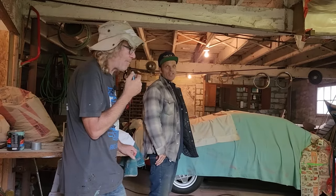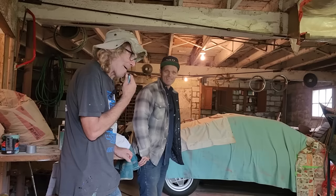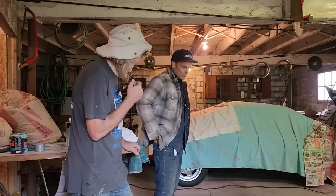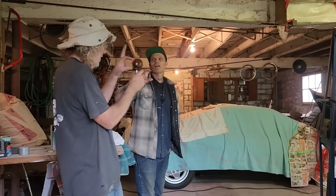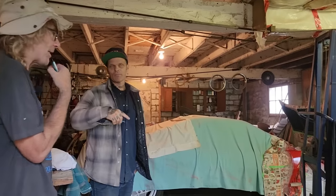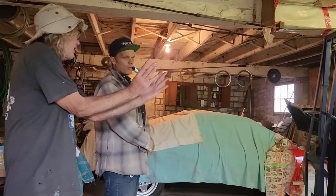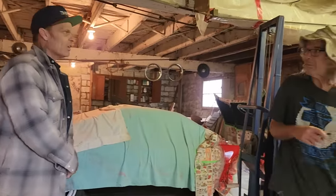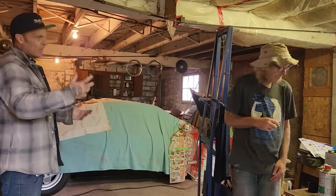Got lots of camera time, sweetheart? Well, I'm impressed with that information on how to read those cups, because that's not how I did it. You're doing the exact same way, but the cup, I don't know if it would have measured right, but your stick would have measured right. I didn't use the stick. I used that one column, four parts, one part, and two parts. If you would have used the stick and gone four, one, I think that. Is the stick calibrated with the can going bigger like that? No, but the stick is just one every time, and I can't say it would throw you off that much. I do it all the time. I like my paint a little thin. I like a little more reducer than most, because that way I don't have a problem with it.